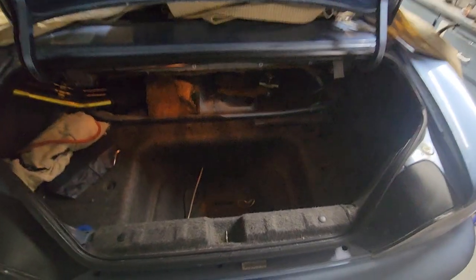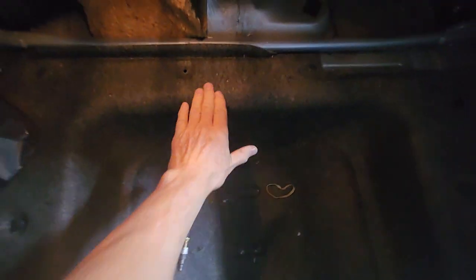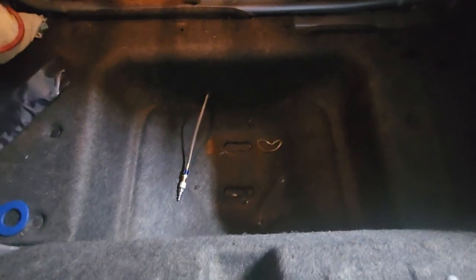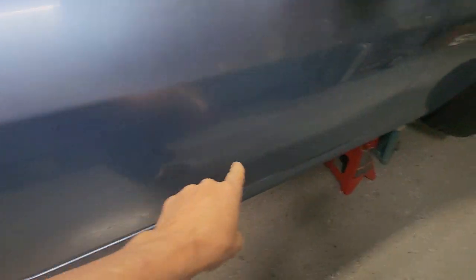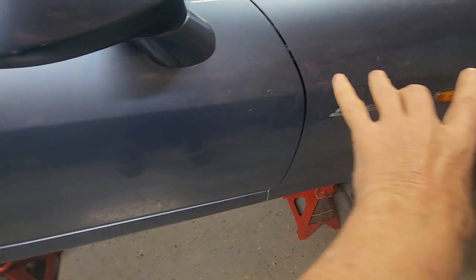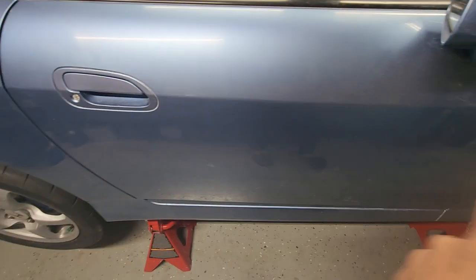Here's the trunk — there's the well it's all going to go into. The top of everything will be about even with the trunk floor, so there'll still be room for my golf clubs over the top. The charge pipe will go down through a hole here, under the car. There's a frame rail that runs along there, and I'm going to run a two-and-a-half-inch aluminum pipe along that frame rail in three-foot-long sections held with rubber couplings at either end.